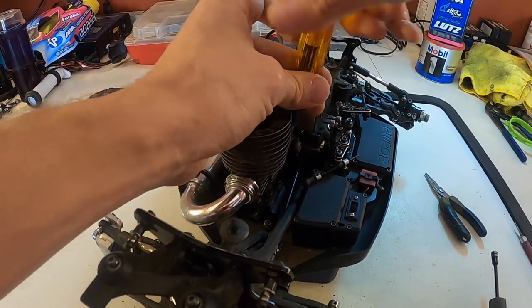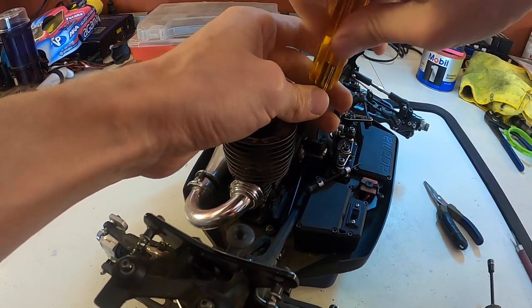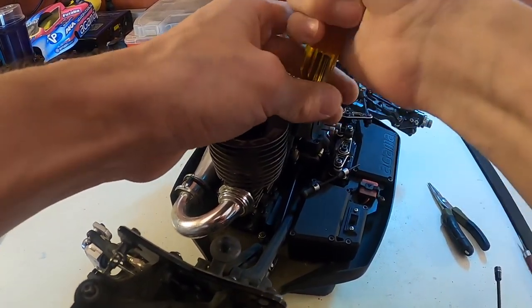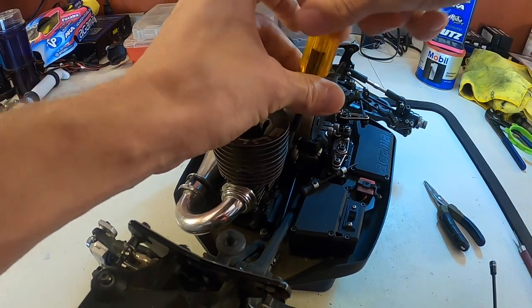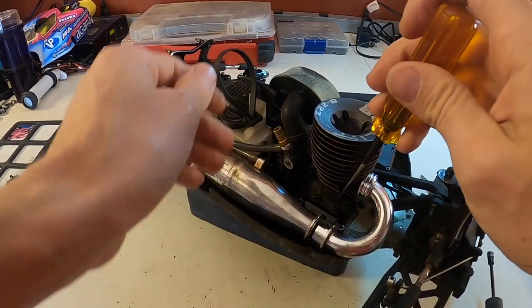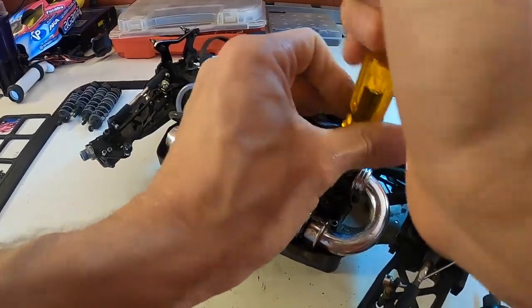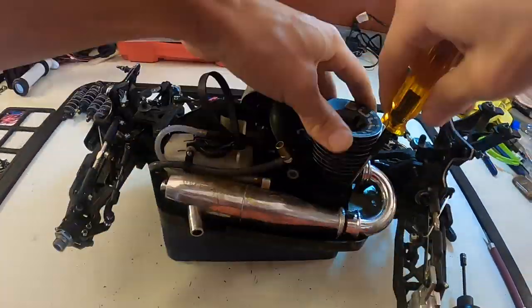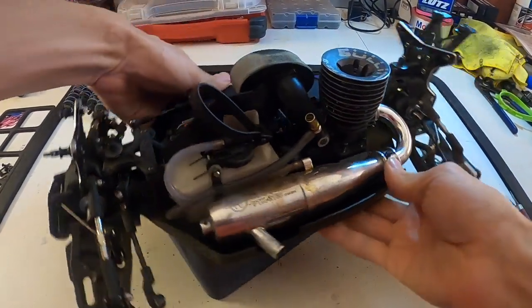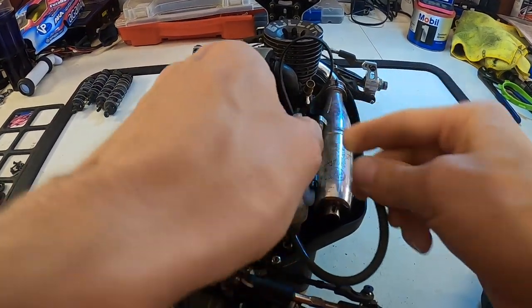A little bit by pressing the engine towards the spur gear or away from it. I like to leave the bottom screws because you don't want those falling out during a race, and generally once you have it all set you don't have to adjust very much — just fine little adjustments depending on the wear of your clutch bell and spur gear. Once those four screws are loose...